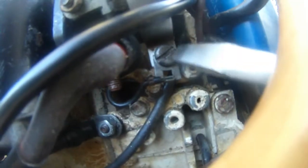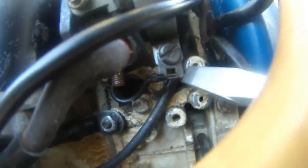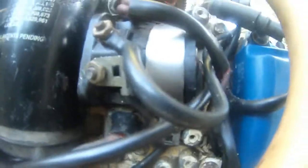The solenoid is fixed permanently on the engine block, as well as what's down here. There's a black wire over here that locks into this one, which is the ground as well. But this was not grounding to the engine block, so the solenoid shook loose — and that's why I got no click. Now it should work.